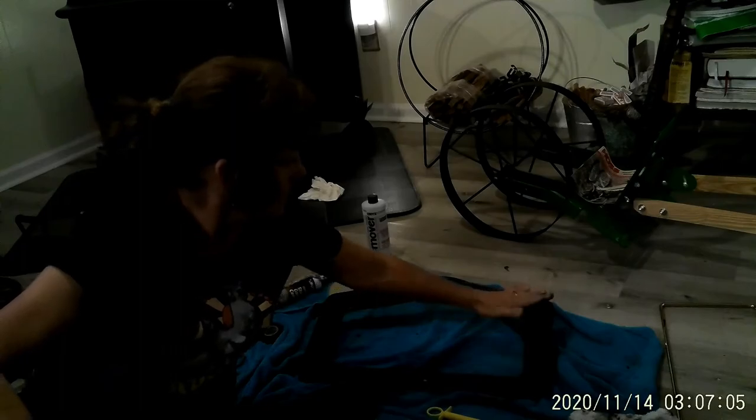All right. That's it. So guys, thank you so much for watching. The next step is putting in the window and putting in the other gasket. That'll be on another video. I'm really happy about this project. Got this part done. This takes about an hour. You got to let it set at least an hour to 24 hours. I'm going to see how it does in just a little bit. What I like to do, if it's good within an hour, is go ahead and put the washer back on, put the door back on, and close the door and give it some pressure.